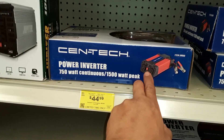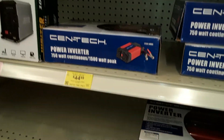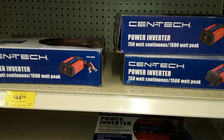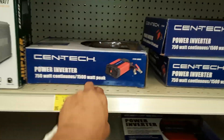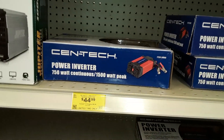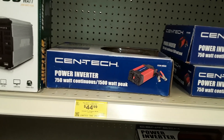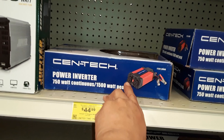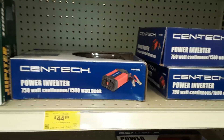If you're cooking though, it'll pull power out very fast — pulling around 300 watts will drain the battery in about 10 to 15 minutes. So to cook, I typically have to start the car up and leave it running while the inverter and rice cooker are on. Watch my playlist for the Cooking with Inouye inverter cooking system to see how that's done. At its very simplest, all you do is get a 400-watt or 750-watt inverter, open up your car hood, hook up the connections, plug in a heavy gauge extension cord, and at the other end plug in your device and you can cook. I ran an extension cord from the inverter mounted under the hood directly into the back of my van, giving me 120-volt power access inside.